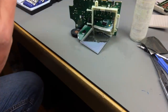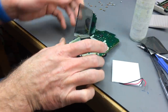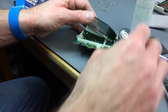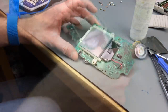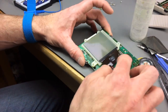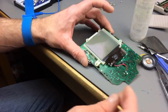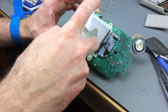The backlight should go in there with the cables to the bottom side. So that's our backlight installed. We're getting power from the points on this little capacitor here. The side with the stripe is the negative one, which is the black wire, and the other side is the positive one. We have to solder our connections there and we're probably good to go.